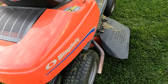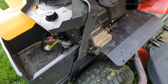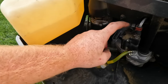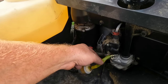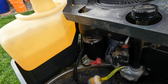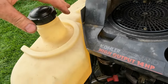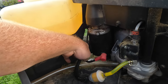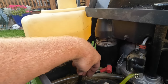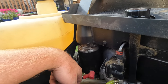This thing's been running about 40 minutes and it did not shut off like it was doing, so hopefully it's fixed. If not, I'll probably make another video on how to replace this fuel pump. But it looks like it's working really well. My conclusion is I think there was some crud in this tank that was clogging up the outlet and not letting fuel flow, because the carburetor looked pretty clean, so I don't think that was it.